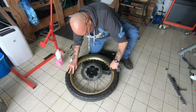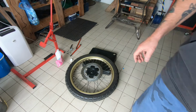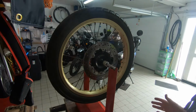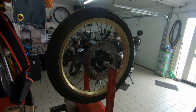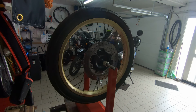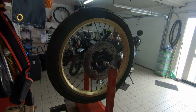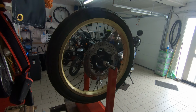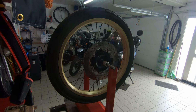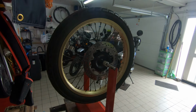Right, I tell you what, I want to get this all nice and clean, so bear with me while I get this off, right? Because there's no point you sat there while I'm doing this. Okay, so cleaned it all off. I'll tell you something, it was a bit awkward to get off. It was stuck better than you think. So let's see where this rests to now, right? Okay. I would imagine it's still going to drop down to where the valve is. And that's going to be our heavy spot. Still, I would think. But hopefully, turning the tyre round should have changed things, we'd like to think.